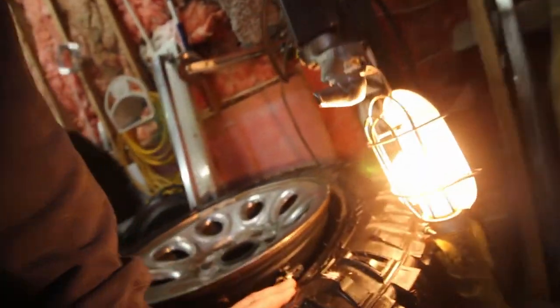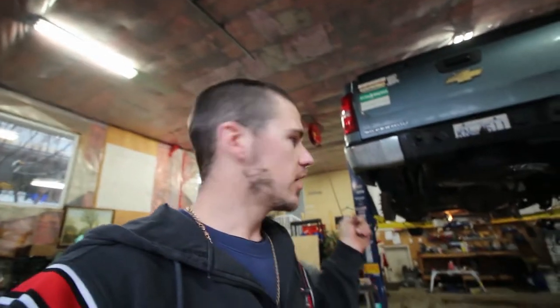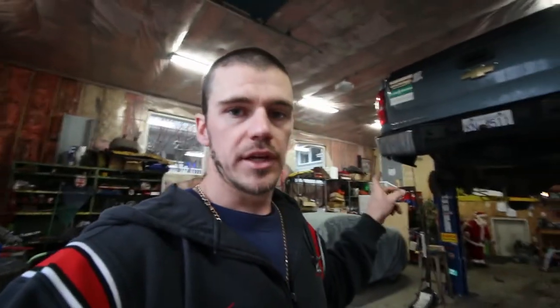TPMS sensors - there's a certain process you can go through with these trucks. You can put the ignition to the on position, hold down the lock and unlock button simultaneously until the horn beeps twice and it puts it into an active tire learning mode. What it does is you go to all the wheels, starting with the front driver's, and you just deflate it. As it's deflating the horn will honk, which tells it that's the front driver wheel. Then you go on to the front passenger's wheel and so on.